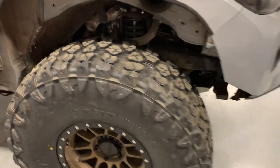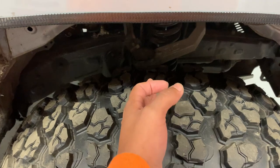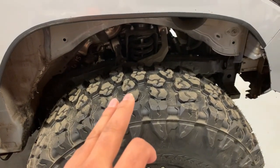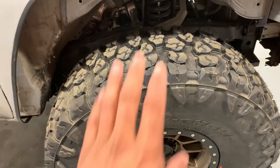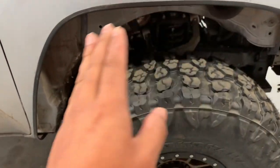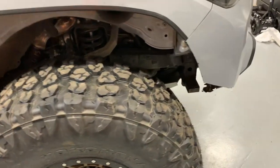I also have SPC uppers coming. My plan is to max the caster out on the lower control arm, which will bring that wheel forward as much as possible. On the SPCs I'm technically minimizing the caster from the upper control arm, but that's also going to help push the wheel forward. Once I get the SPCs and do my adjustments and put the cam tab deletes on the lower control arm - and if you remember from my last video, I have BTF Fab high-caster lowers coming - once those are here and I put my adjustments in and get the tires as far forward as possible, I can start doing my tubbing. I don't want to start tubbing anything until I have all the geometry set, because it doesn't make sense to start cutting until you know where the tire is going to hit.